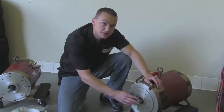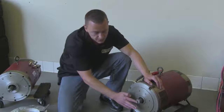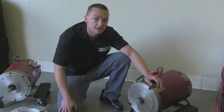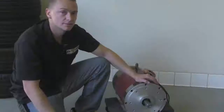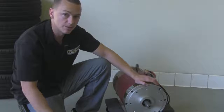As you can see at the end, I took the tool and just kind of ground over the end and over the edge of the splines. That's to knock down any burrs or anything that would hinder the coupler from sliding on. We're finished with the first motor — let's go ahead and do the same thing with the second one.